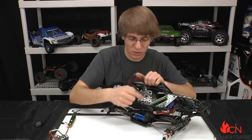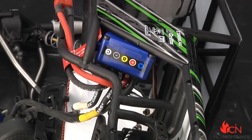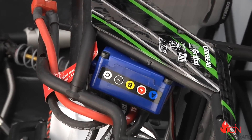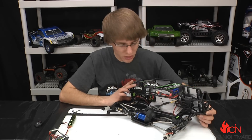On top of that, I found a nice stock bolt mount for it. The body has all these screws holding the lexan in — I replaced this screw right here with a 3-millimeter screw that was about 15 millimeters long, went right through, and bolted onto the stock Velineon mount. So now the Velineon ESC is bolted in there — no modifications, no tape to worry about coming loose. It was a really clean install and it worked out pretty well.